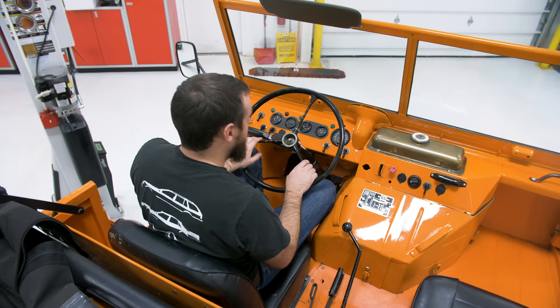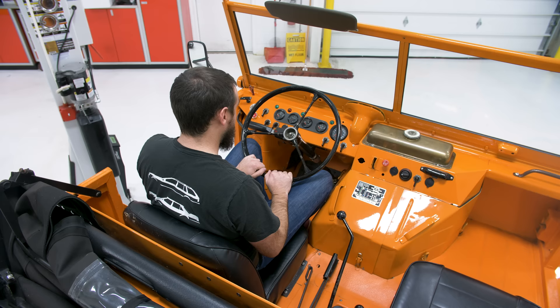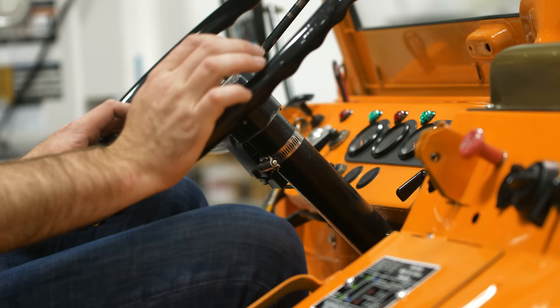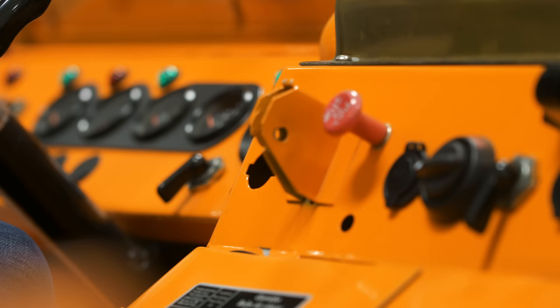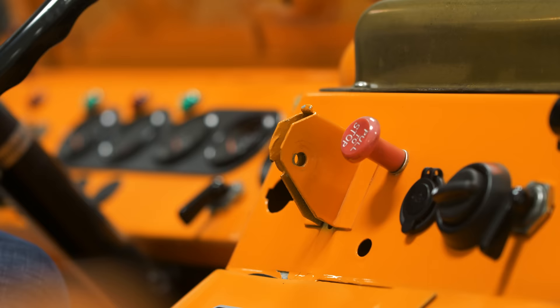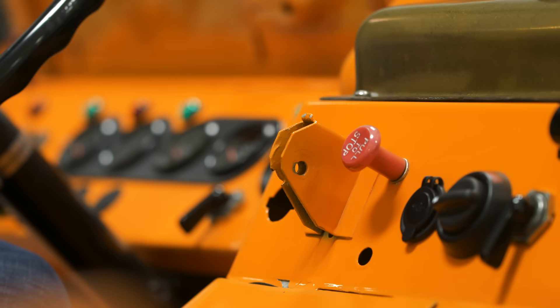I've got just a universal turn signal here. The steering column is quite a bit different — it would have been moved over a little bit originally and straight to the manual steering box. Now I have a little bit of linkage and some U-joints that go to the power steering box, which makes it a lot nicer to drive. This bracket is supposed to be for a hand throttle, which I haven't gotten around to yet — just if you had PTOs or were doing off-road stuff and wanted to bump it a little off-idle, or kind of a cruise control mode.